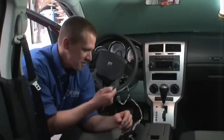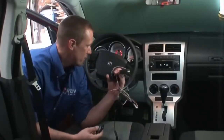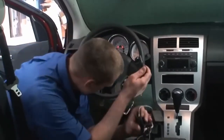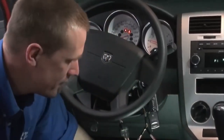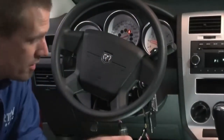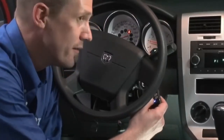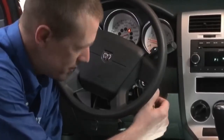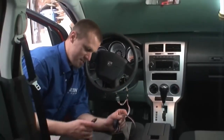Okay, we've already done a remote start, but what we need to do is a remote takeover for idle mode. So we're going to remote start the vehicle. We're going to insert the key. We're going to hit the brake, and now we can drive away. And we can also continue to use the keyless entry on the remote start. The customer simply gets out and can arm the system.